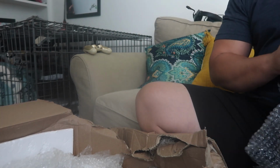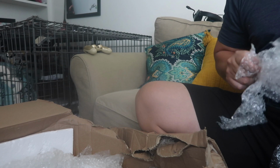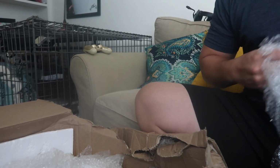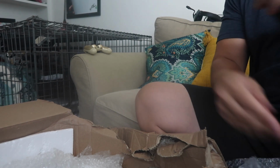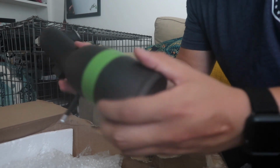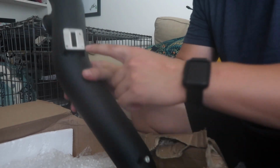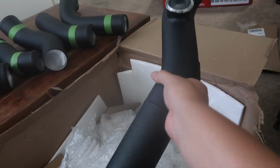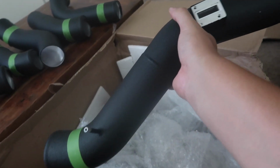So this looks like probably the intake pipe going from the intake manifold. It has the MAF port on here. Yeah, and then for the blow-off valve, of course, it is V-band. So obviously 2 throttle body, vacuum there, and then obviously for the mass airflow sensor, but I will not be running a mass airflow sensor since I have the Haltech. So obviously it's a MAP sensor, not MAF. So I have that one there.